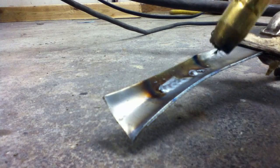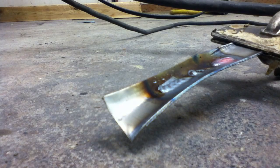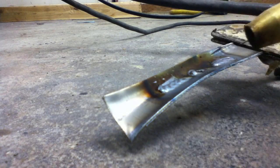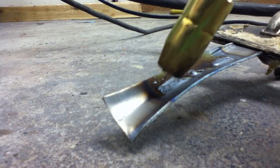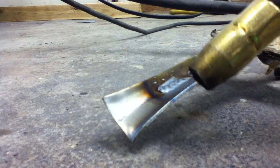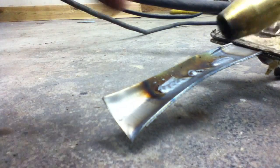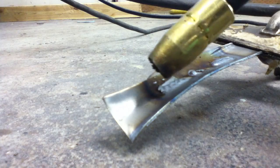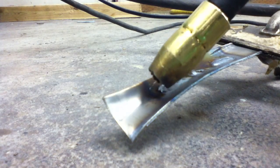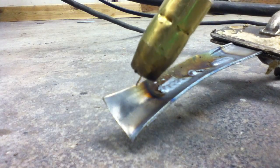Let's get started. Not much popping — nice and sizzling, pretty good. As you can see I went at it sideways and across. The more angle you have, the colder the weld; the more straight on you are, the hotter the weld. For thin sheet metal like this you want it as cold as you can get it, because if you go too hot you'll burn right through. But if you go too far sideways your line is going to smack on it and you'll get a bigger hole. Find the perfect angle where it sounds the best and works the best.